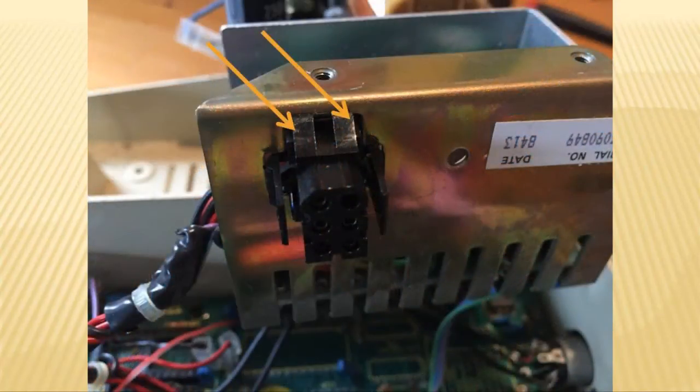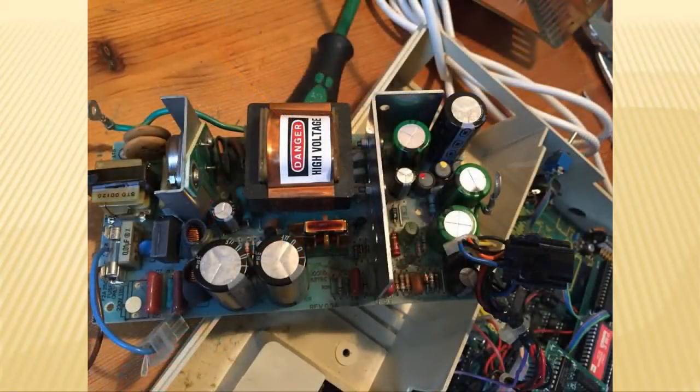Next, we have to remove the power socket that sits underneath, and I found this quite challenging — it took about 15 minutes. You actually press the top two pieces of plastic and slide the socket back at an angle to get them under the metal. Then repeat this for the bottom two so that there's room to slide the entire socket back into the inside of the power supply. Now the power socket is removed, and you've taken out everything that prevents the unit from sliding out of its metal chassis.